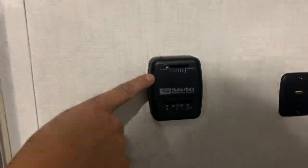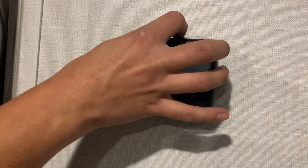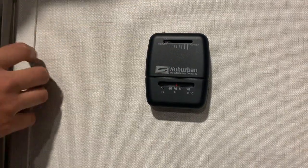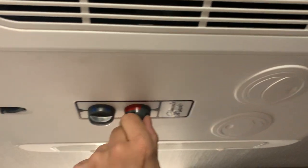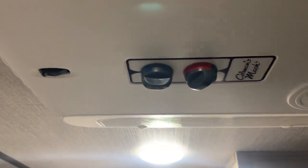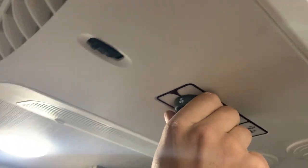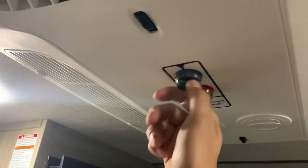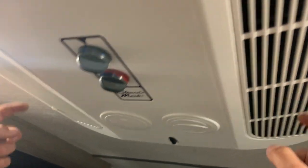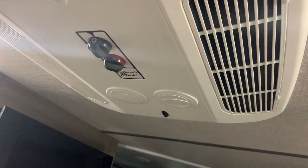You've got your thermostat for your furnace down below here. With it the way it is, it's off — clicking it all the way to the right is its hottest setting, anywhere in the middle is warmer or cooler, and then all the way to the left to click it off. Whenever you do turn it off, the furnace runs for about three minutes just as an added safety feature to cool down. Controls for your air conditioner are right up here — you've got a few different louver options you can close and open to move the air around how you'd like. It's going to show a hot setting, but that's for if this was equipped with a heat pump — this one isn't; it is just equipped with an air conditioner. Turning it once you get low fan, one more time is medium fan — that's just the air conditioner moving air around with no actual cooling. High fan, and then you get to the blue setting, which is when the air conditioning cooling takes effect. You've got two filters right underneath here — just pull these tabs and they'll pop right out, allowing you to slide those filters out so you can give them a blow off with an air gun, as sometimes they do get a little dusty.